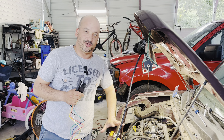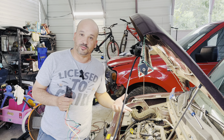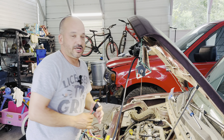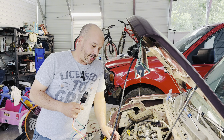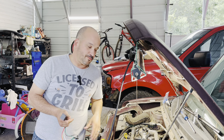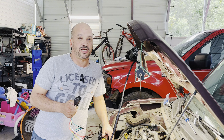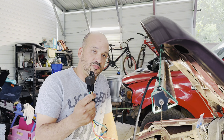One thing about rural vehicles that you use on a mail route — you're going to go through a lot of heat cycles that a normal vehicle is not going to have. And one of those things that is going to fail is going to be your radiator fan switch. You can go track down relays and replace relays, but a lot of these newer vehicles it's also controlled by the computer. The easiest and best thing you can do is just replace it with an aftermarket relay and temperature switch.